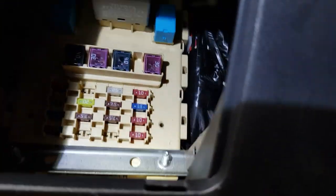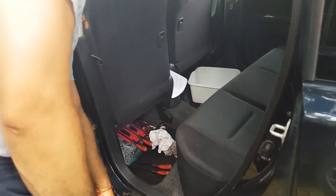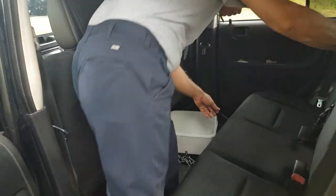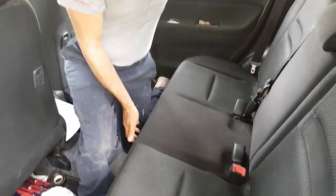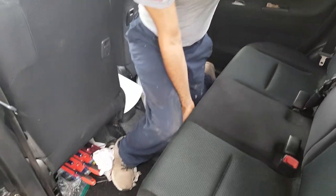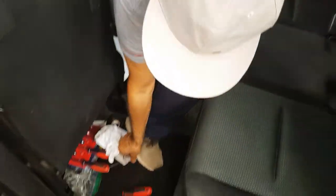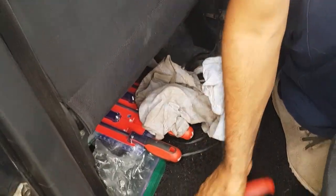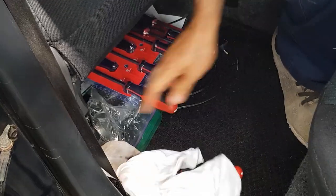Relay is back installed. All right, it's in — access to our fuel pump. We've got to remove the bottom seat; I already took the liberty of cleaning everything ahead of time so we don't waste too much time in this video. Usually you just push down hard. This procedure is for 2006; the 2005 may be a little different. I've got my rags prepared and two flat-head screwdrivers with tape around the edges so that way we don't damage the connectors on the fuel pump assembly.